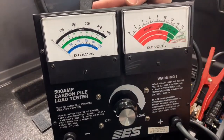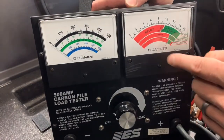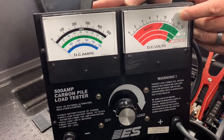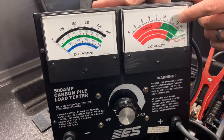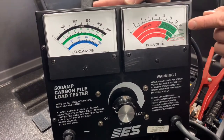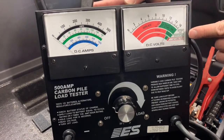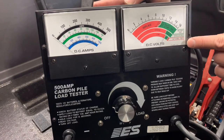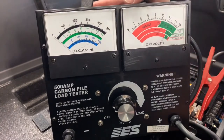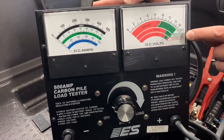This tool has got two dials, which is fairly typical of a carbon pile load tester. One is showing me where my amperage output is at, as well as my DC volts. Right there I'm just under 12 and a half — we did a couple of tests with the electronic tester, so we've lost just a little bit. There are several things on this dial to look at: minimum voltages for the battery test, state of charge, and alternator output, so I can see if I'm getting elevated voltage when I run the car.